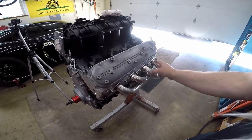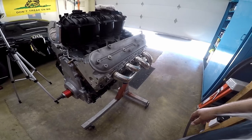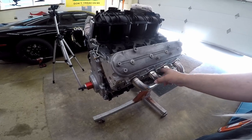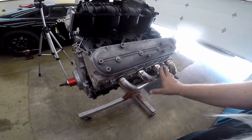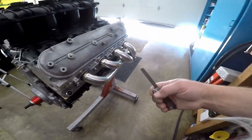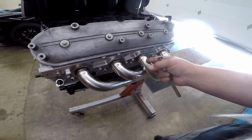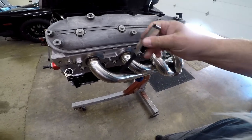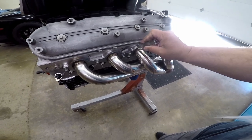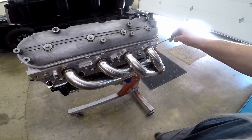The most common response I saw was: 'Did you try bolting them up to the cylinder head and see what it does? No gasket — just bolt them to the head, make sure you got the right length bolts, and take a feeler gauge to it.' So that's what I did. I started in the center and just started torquing it — not over-tightened, these are tightened to factory specs, which I believe is 18 foot-pounds. Then I just went around with a five-thousandths feeler gauge, top and bottom, and made sure I couldn't get it to go in anywhere — and I couldn't.